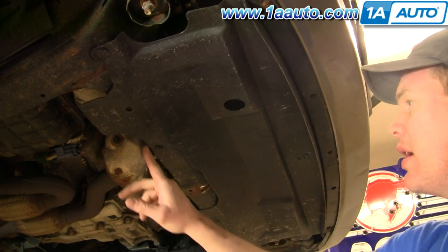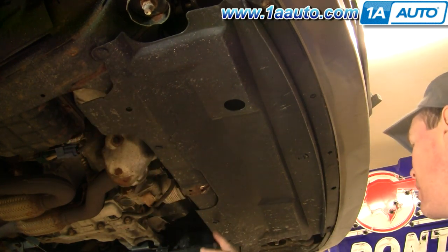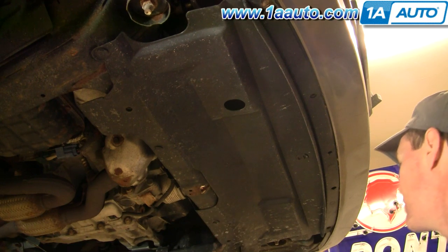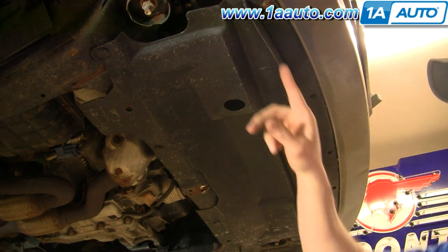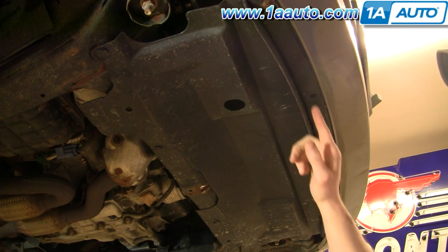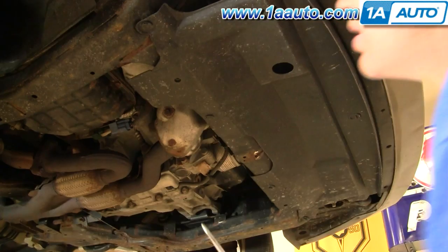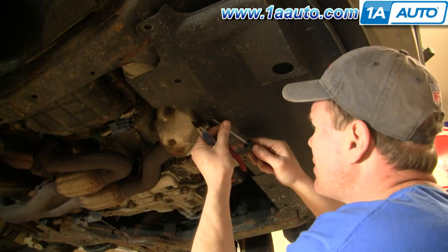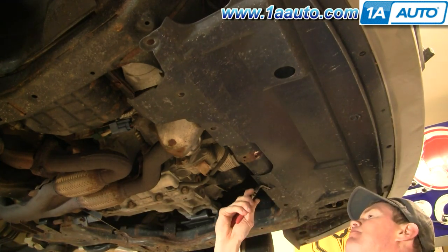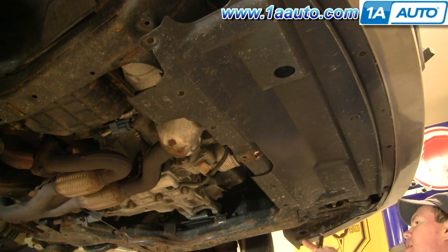There's a series of pins on top, and there are six right across here. It looks like this vehicle's been apart before — it only has two of the original ones, one's missing, and it's got a different style over here. There are also pins along the bottom. They're a little more difficult usually because sand and dirt has gotten in, making the clips difficult to get apart, so you'll probably need a screwdriver as well as a pair of needle-nose pliers. You pry the center out and then pull the clip down.